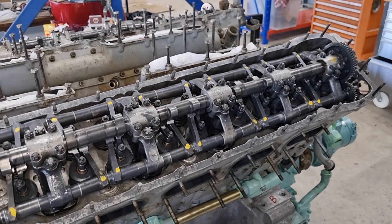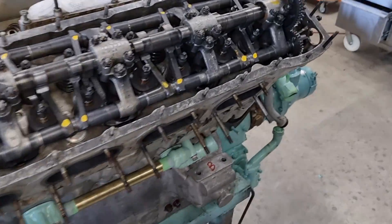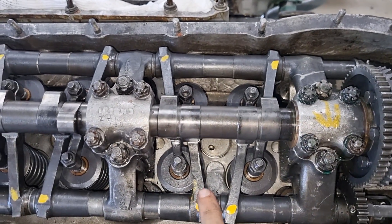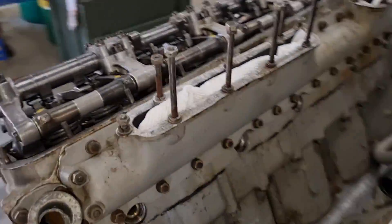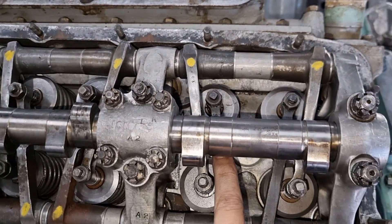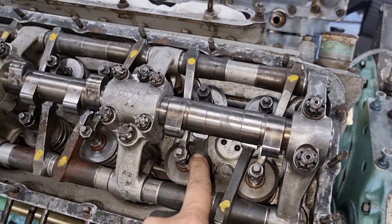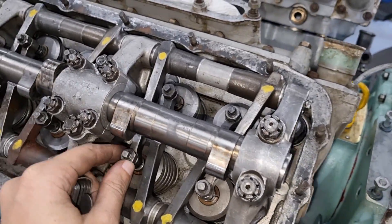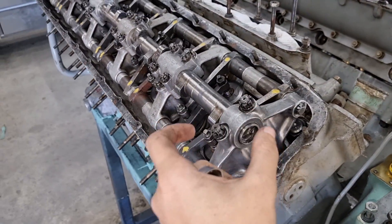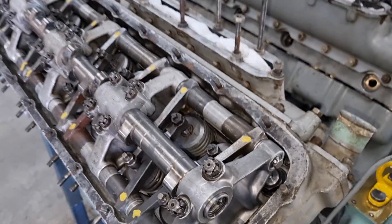And that is what we need to do in preparation for the valve timing — everything is very essential. Fun little factoid: in the manual, these two here — bank B6 inlet and A1 inlet — it says to set these to 35 thou, and that is for timing. We don't bother with that because we've never had to. Eventually you do need to set these back to 20 thou, but that just gives a little bit of advance on the valves. You don't really need to do that.